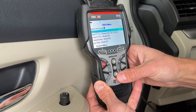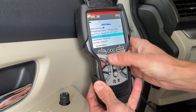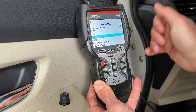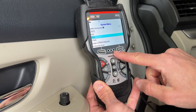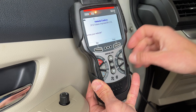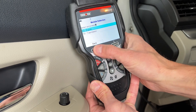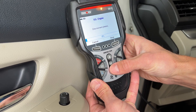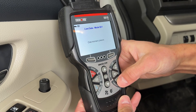From the OBD2 menu you can go through the different systems. When you go to the system menu and check OBD2, it gives you several options — you can go through the ABS system, SRS airbag, tire pressure, and other scans like the scan all modules option. The lights here indicate status: green means you're good, orange means you have some minor faults, and red means you have some serious faults. You press this button to go to the next menu, and if you go to the Subaru section it will show more specific parts for the engine and transmission.